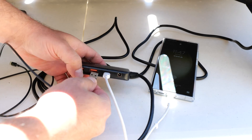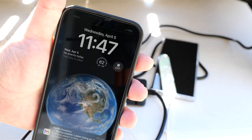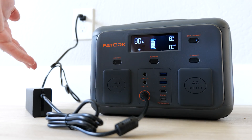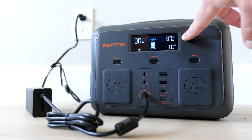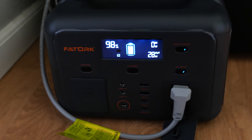Push it in and it's charging right away — says super fast charging. While that's charging you can also connect another device and plug that in — 41% and it's charging. For the next test, we're plugging in the power adapter that comes with it, rated for 90 watts. It can output 90 watts according to the AC to DC converter — currently giving 30 watts, and the highest I've seen is 87 watts, which is expected since devices rarely hit their rated number exactly. Since this is a 518 watt-hour battery charging at 87 watts, rough math says it'll take about six hours for a full zero-to-100% charge.